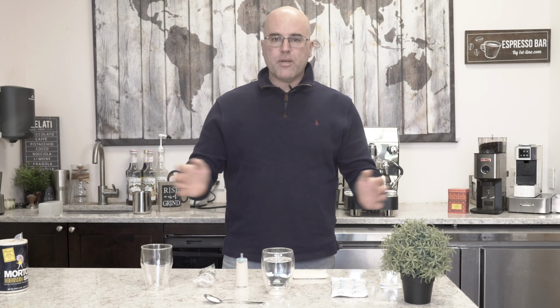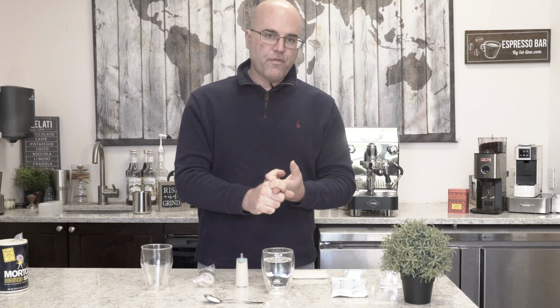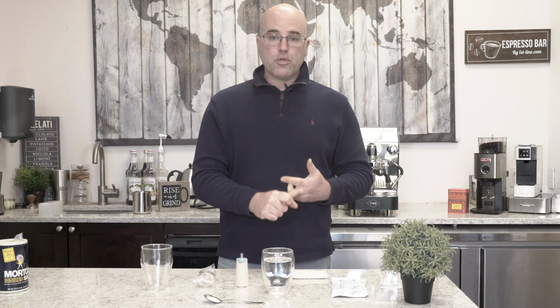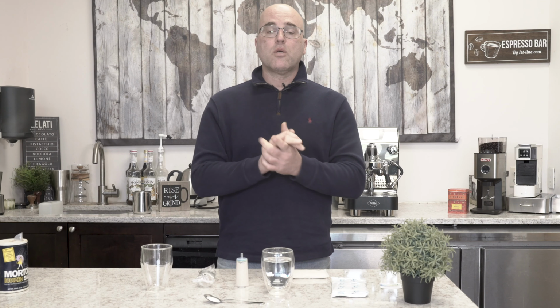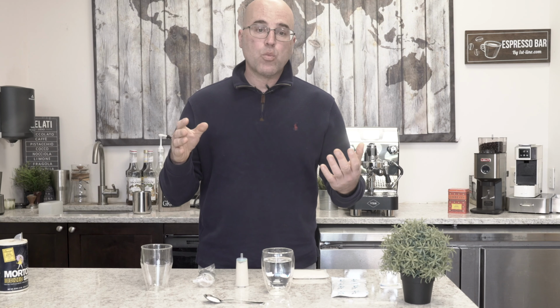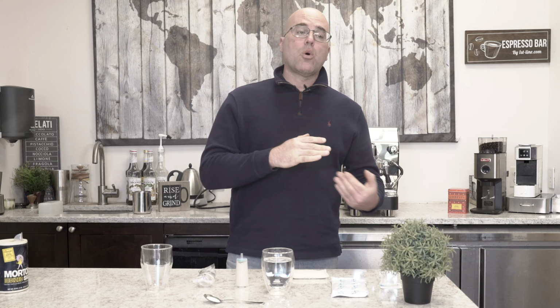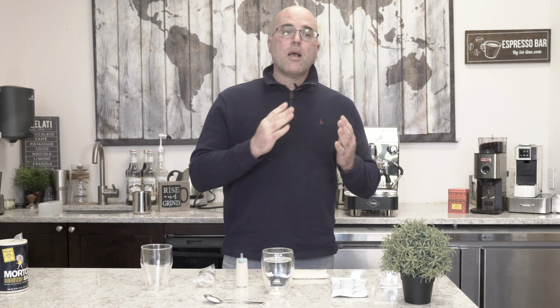Let's backtrack a little bit. Do not use distilled water, do not use purified water, and don't use reverse osmosis water. The simple thing is, those waters can start eating away and oxidizing with the metals, which can cause some similar effects as limescale.